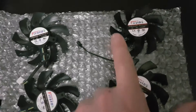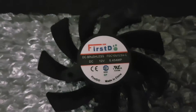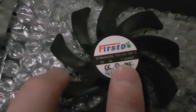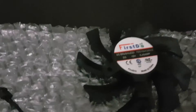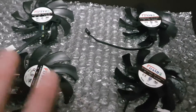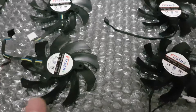Our replacement fans have come in for the Dell 3060 Ti. The part number is a little different: 10U12S9-C compared to the original 10H129-C. The biggest difference I see is the amperage — the original is a 0.35 amp fan and these new ones are 0.45 amp fans. These could just be Chinese knockoffs, but I'll put a link in the video where I purchased them — I got these from eBay, specifically for the 3060 Ti Dell graphics cards.